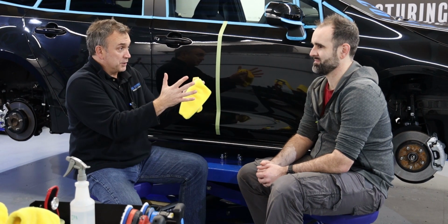It's carried away. So microfiber, in my opinion, if people get past the scariness of how aggressive it could be, the actual way they polish is a slightly different process. There are different results, but they're positive results, I think, in that you've got a clean surface afterwards. We adjusted, and we didn't get as much micro marring as I possibly wanted to show you, but we did prove yesterday that the one-step orange pad gave a much better gloss from a one-step. Now for this process, I'd recommend 2 steps: heavy cut and refining.